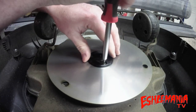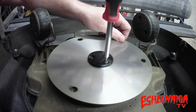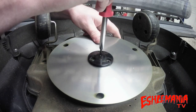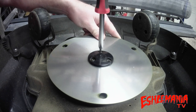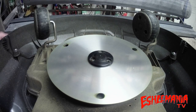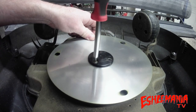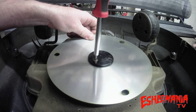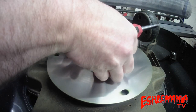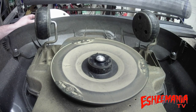But if you want to make sure your automower is running at peak performance, think about it like a conventional mower — you wouldn't just slap new blades on without cleaning the mower deck. Here's a suggestion: take your Torx bit and remove the three screws holding the center cap on, then take the shield off over the mower blades. This way you can get in there, check for debris buildup, clean out any gunk, and help keep your cutting system balanced.